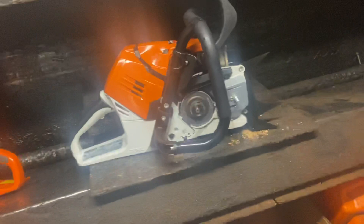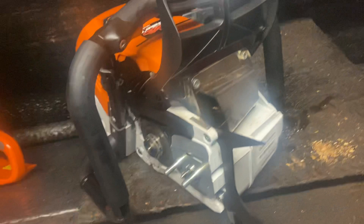This one's got the three spike dogs on it from West Coast Saw's Bark Box. I ported it. I'm putting the good side cover on it, and an extra washer on the air filter so those fines don't come in there.